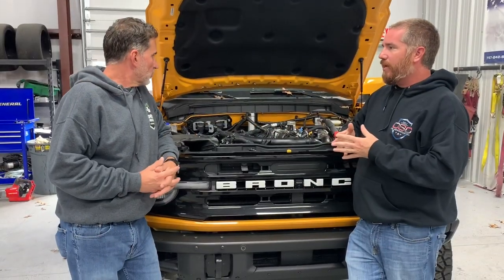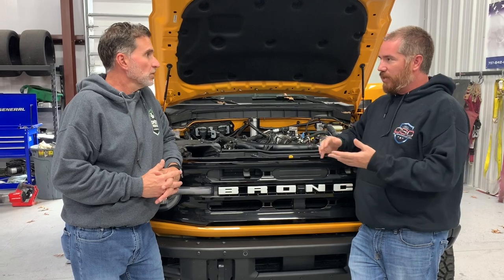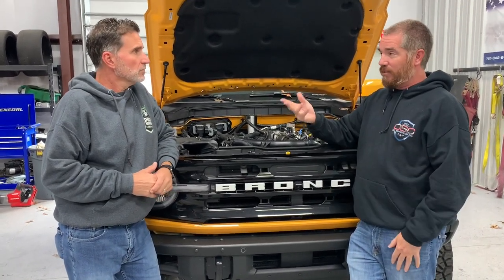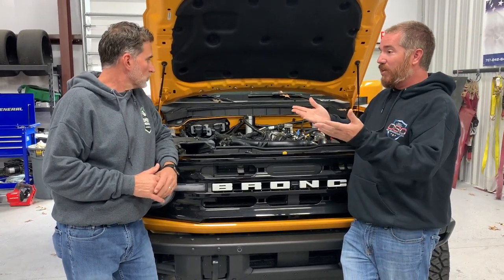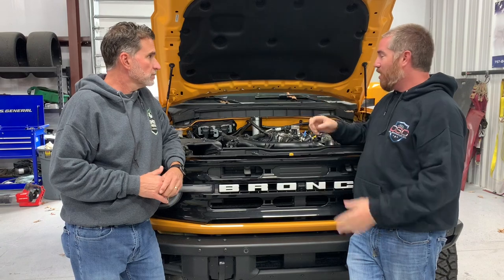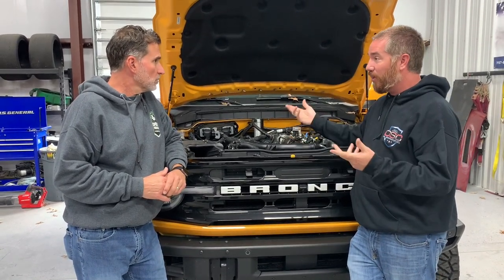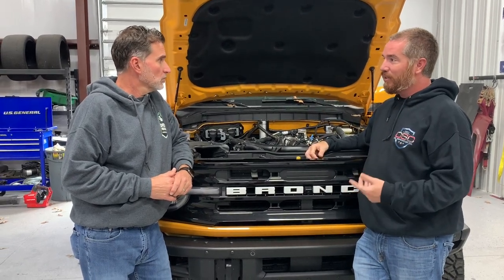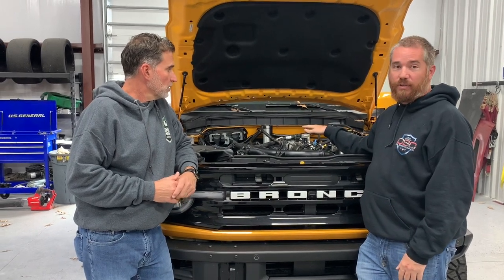You know, you talk about atomization of oil. Different oil types can affect that. Sure. A big thing, obviously, people are huge on AMS oil. There's a great YouTube channel that does lots of testing on oil where they test it for how much evaporates at a certain temperature. All that's going to affect collection rate in your oil separator, but also if you didn't have an oil separator or you wanted to go a long period of time, running a good quality oil can help significantly in keeping buildup down on those valves.